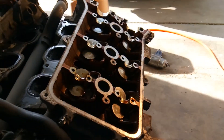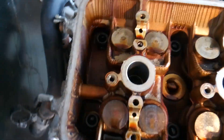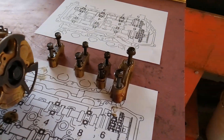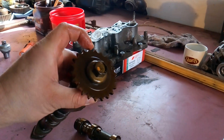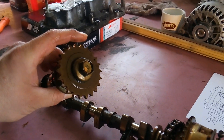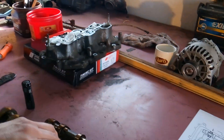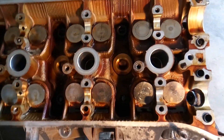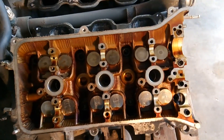And there you go, folks — that is how you remove the camshafts out of a Toyota 4.0. Now that I've got it all opened up, I can clean all that up, and this will allow me to work on replacing this gear. I can go ahead and get this off and set that up accordingly, because what I want to replace is this gear right here. Now I can just hold it in place and do whatever I need to get that bolt off without worrying about damaging anything internally. Since all the camshafts are removed, I guarantee every single valve is currently closed, so we're not concerned about piston and valve clearance.